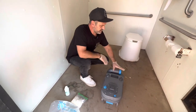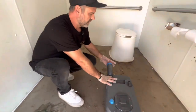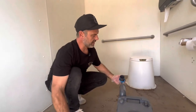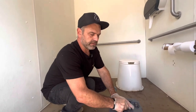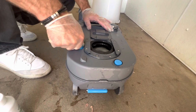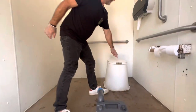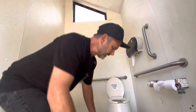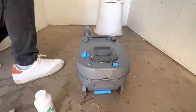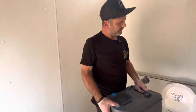As we talked about earlier, we've got our vent button, our arm, and our measuring cup. The measuring cup slash cap is for both disposing and treating the tank. I'll put it back on just for a moment. We also talked about the operation of the blade — I've got it open just so we can see what's going on. To get started: lift up the lid with gloves on because you never know. I'm going to take off the measuring cup and set it away from the disposal so it doesn't drop in there.